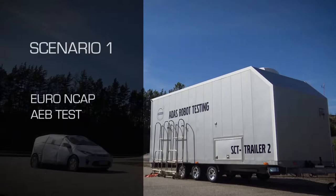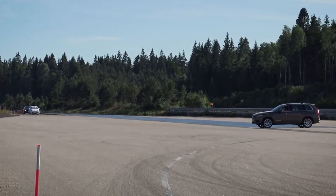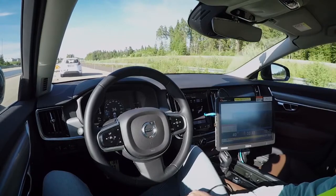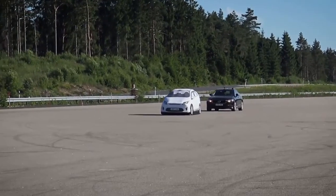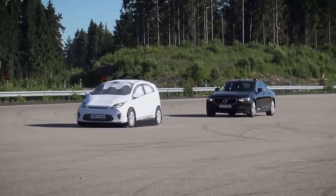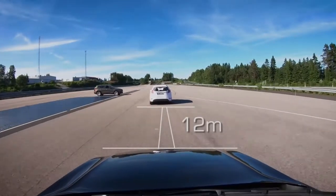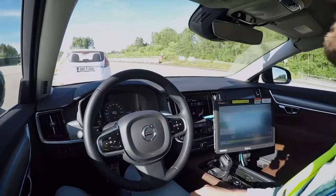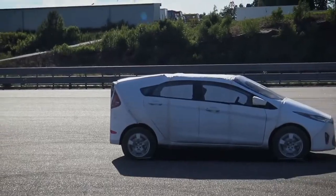ADAS testing requires the ability to precisely position the vehicle on a track, but more than that, you need to be able to coordinate your test vehicle with other vehicles or moving dummies. This tests the vehicle's ability to detect and avoid an impending collision. Here the Flex Zero is used to drive the subject vehicle behind the guided soft target to perform a Euro NCAP AEB test. Until now this test has normally been undertaken using driving robots, but here the Flex Zero is used instead. In the CCRB manoeuvre, the two vehicles travel with a fixed gap between them before the GST decelerates. Both vehicles are using path following, and our synchro technology is used to ensure the correct relative positioning.